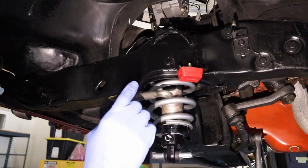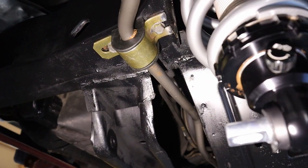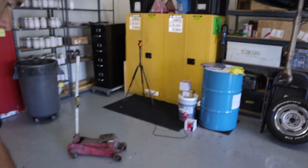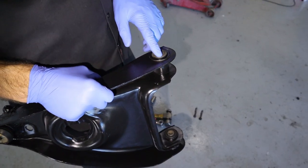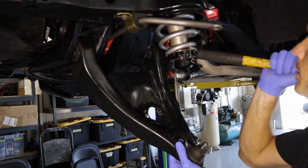Now I'm going to install the passenger side coilover the same way. The car needs to go up in the air. The proud Camaro owner has the sway bar all cleaned up, and we've got new Energy Suspension sway bar bushings and end links on it, and the new bump stop installed. Now we're going to put the lower control arm on. I've got some lube on the bolts so they don't seize in the bushing sleeve if you take it apart later.